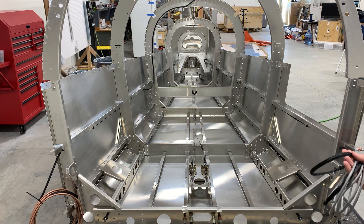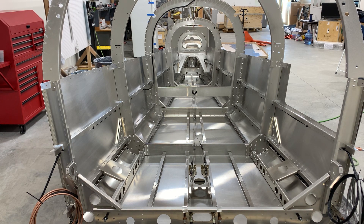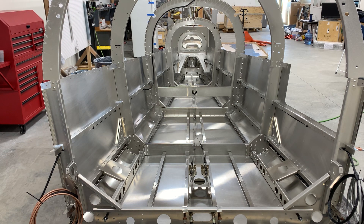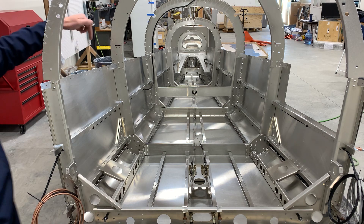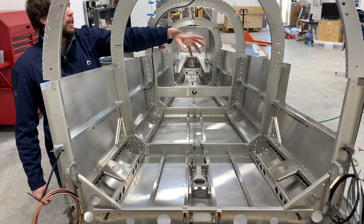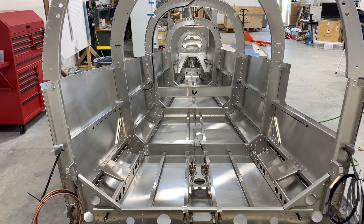Using wire jacket keeps everything well protected and nested through here. At this stage of the build, you need to have a clear idea of your full avionics setup. If you're going to use a nav antenna, run a wire down for it at the tail. This build also has a coax common antenna run down the longeron and up through rib four. If you plan to use a GPS antenna on top of the rear fuselage, that's also a good option — plan to run coax for that as well.